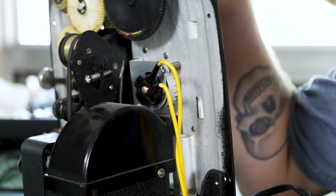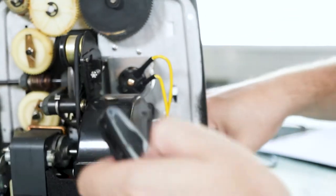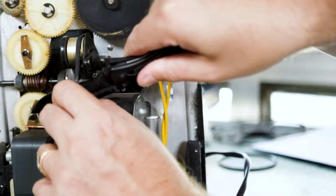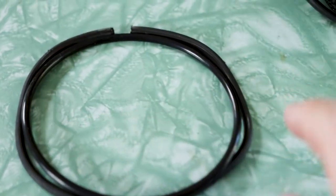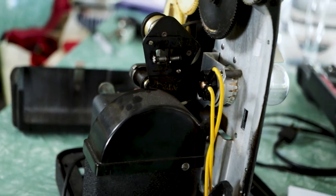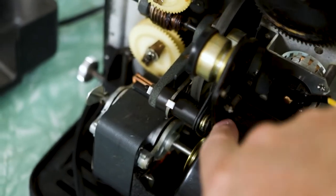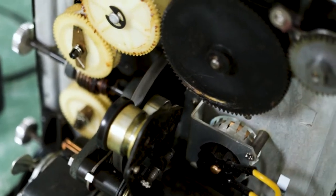Bring this a little closer - you can see the whole thing is just pretty loosey-goosey. We got the new belt here. I'll just cut the old belt off - not very elegant, but I don't care. You can see the new belt is just about a little bit smaller than the old one, which is exactly what you want. This space here is why we have to take this whole thing apart, because the belt needs to go past that. What we're going to do is feed it through the fan housing onto the spindle and then over the drive wheels there.